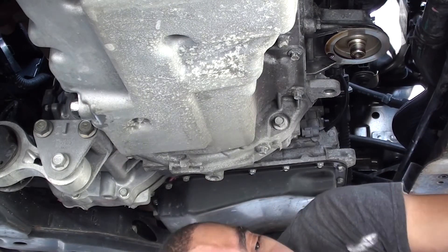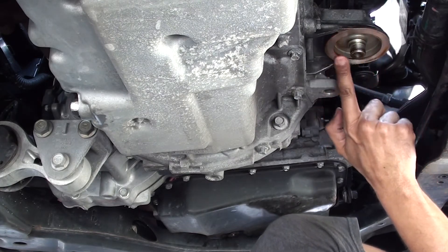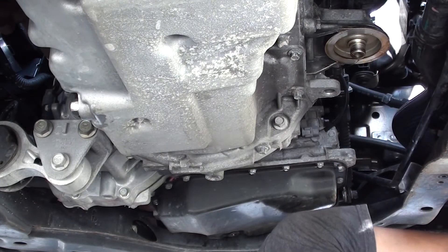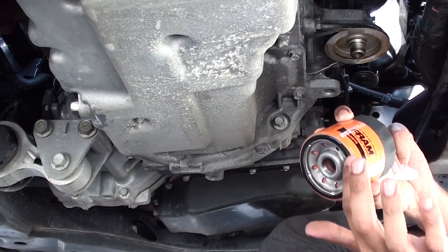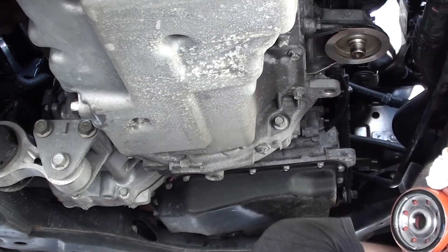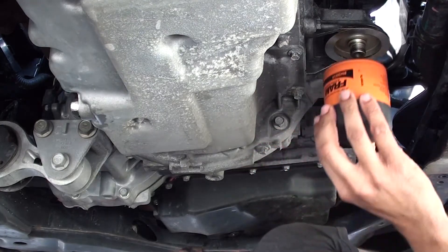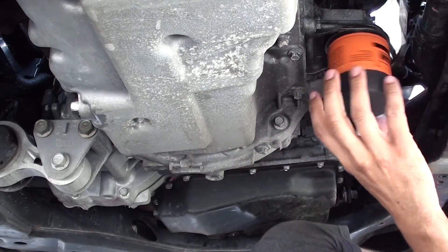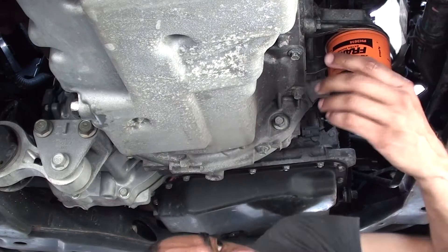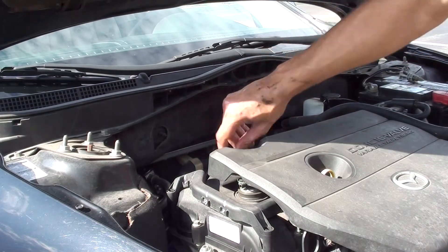What we need to do at this point is make sure the surface here is lightly oiled — not too much, just slightly oiled. Put a little oil on the gasket of the filter, just run your finger around there. We don't need that much oil — just make sure it's nice and slick. Then we run this on just hand tight. That's all we need.